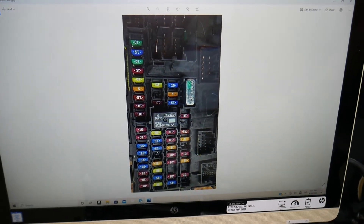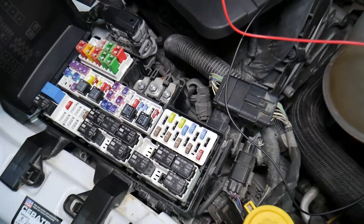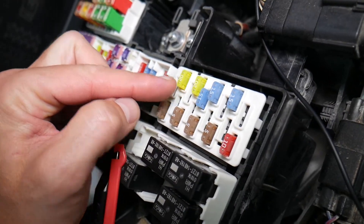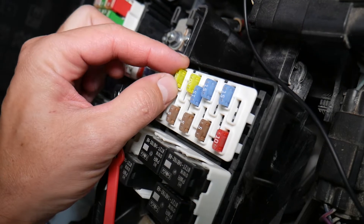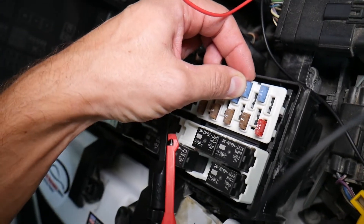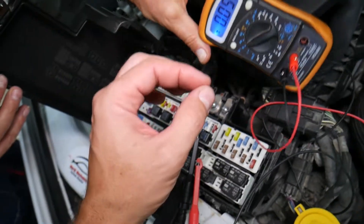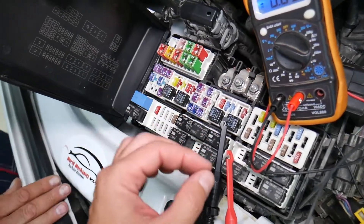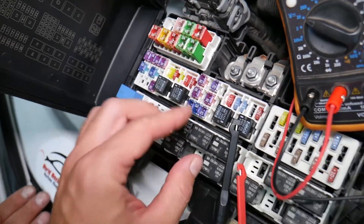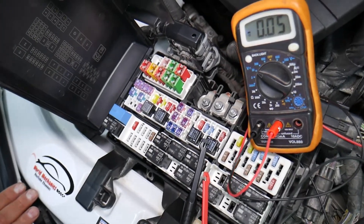Let's explain quickly why it's very important to test fuses and relays. Fuses — not often can you see if they're burned or good. Sometimes they may seem perfectly fine, you think it's a good fuse, you put it back in, and you end up spending money and time on parts and problems that do not exist, when all you have to do is test your fuse, find out it's bad, and replace it to fix your problem. We'll have a video on how to test different kinds of fuses and how to test relays — we'll put the link in the description below.